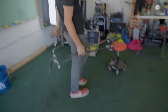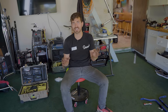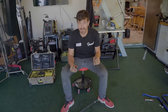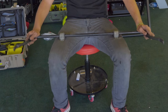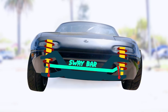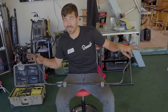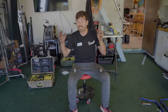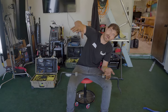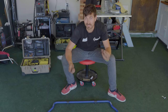Now let's talk about what a sway bar even actually is. It's basically a big spring, and what it does is connect your left and right suspension across an axle. So your left and right suspension on the front, and your left and right suspension on the rear, are connected by a sway bar. Most of the time when you're riding down the street it isn't doing much — if your wheels are doing basically the same thing, it doesn't have much input over driving characteristics. But when you take a corner, the outside suspension of your car is gonna compress while the inside suspension is gonna stand up. The sway bar is connected to the left and right control arms, which are doing opposite things. So this big spring has opposing forces on either end, which twist that spring. Depending on how heavy duty the spring is determines how much it opposes that twist, which in turn keeps the car flat or lets body roll happen.